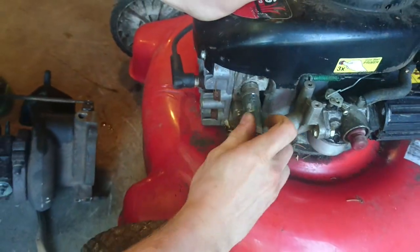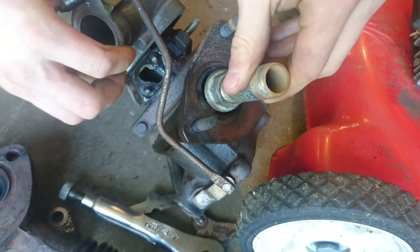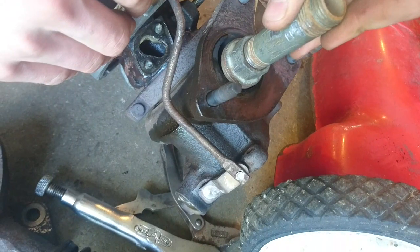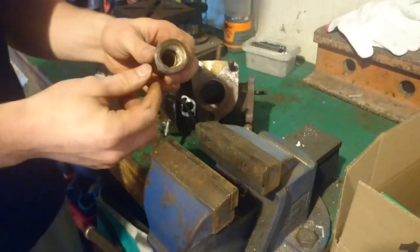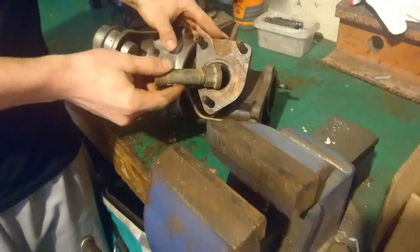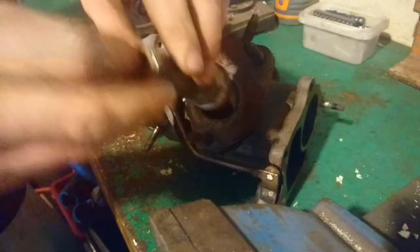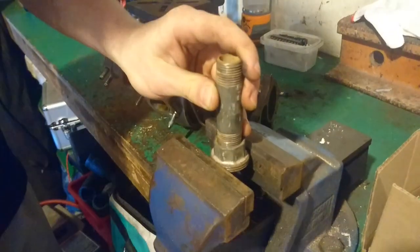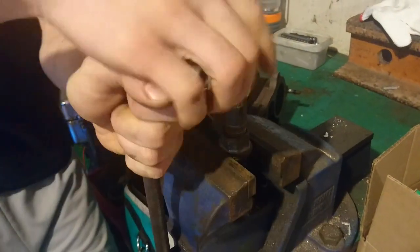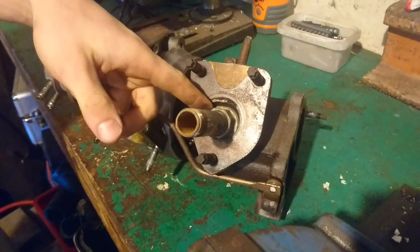The larger side of the fitting, when compared to the turbocharger inlet, is pretty similar — I just need to make it seal relatively well with the turbocharger. What I've decided to do is crush the fitting in a vise to make it slightly oval-shaped to match. I keep squishing it a little more, checking the fitment, and then jam it in there. I'll tap it in with a hammer so it stays, then use some exhaust sealant to seal it up.